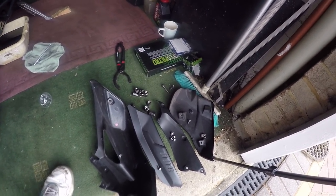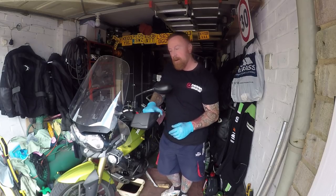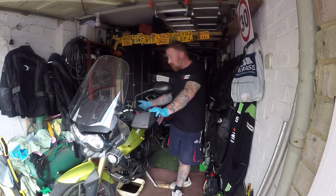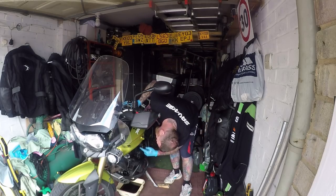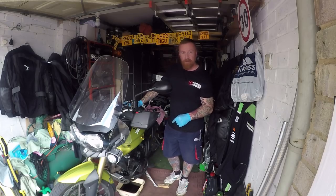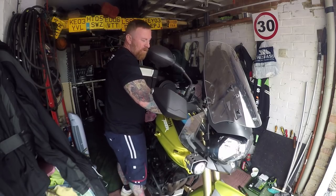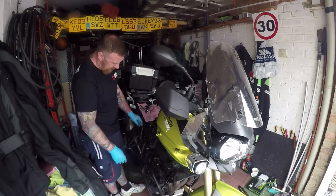Don't lose them. I'm going to put obviously left hand here, right hand over here. I'm guessing this is why you pay so much in labour when you go and get your bike serviced. It is only my time — and when you do it, your time. Air box is here at the back of the tank, so that should be easy to get to. And hopefully get the tank off. Plugs should be easy to get to. Let's get the tank off properly. Let's fast forward a little bit and get the other side off. Believe me when I say that's an awful lot of panels. These two bolts come out, all this comes off, and you slowly wiggle it back. Now I can get underneath — there's a couple of air pipes here that wiggle off; they're returns, they go back the same way.